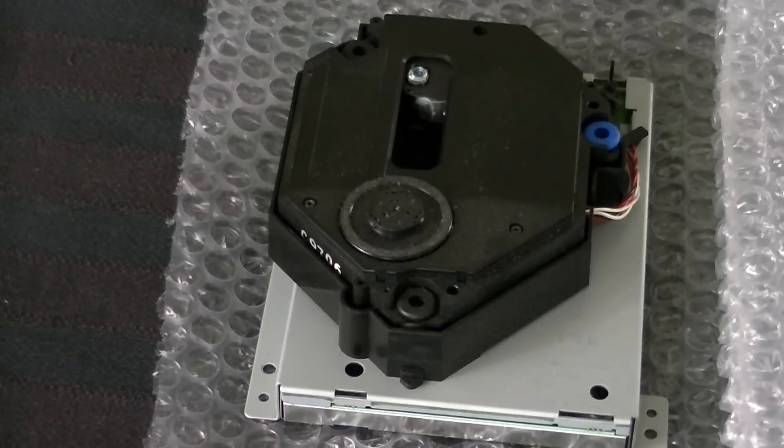One, you could throw the console away — bad idea, don't do that, hold on to it for parts. Secondly, you could try and fix the laser assembly. This is the GD-ROM laser assembly — basically this is the most common thing to go on a Dreamcast. They break with relative ease, unfortunately. The laser itself in there can be replaced, however you need serious modification skills to be able to do that. I lack that ability. But I know it is possible. The alternative is to find an entire GD-ROM unit like this and simply take out the one inside the console and replace it with this one or another unit that's functional.